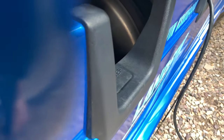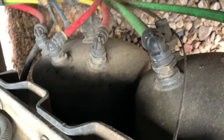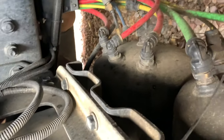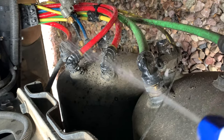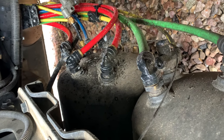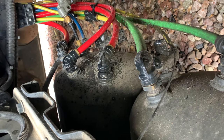No bubbles. And then on the backside of the air tank, there's a mass of fittings coming out of the air tanks with airlines and lots of connectors. So all of those — just take the bubbles and squirt all the fittings, and then you can just sit back for a minute and watch for bigger bubbles. And apparently there aren't any right there.